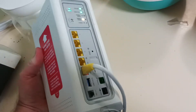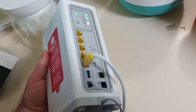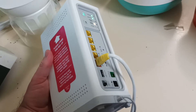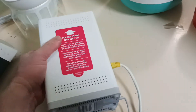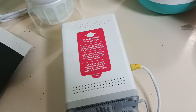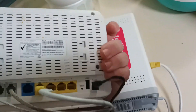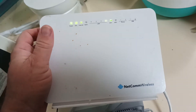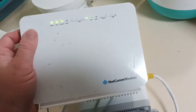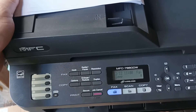In particular, older generation Brother printers: you will never be able to connect an older generation Wi-Fi Brother printer to one of these modems. On the flip side, other carriers like to use Netcom wireless modems, and those will connect to any older generation Brother printer flawlessly with no problems whatsoever.